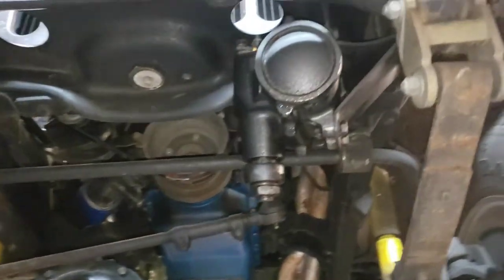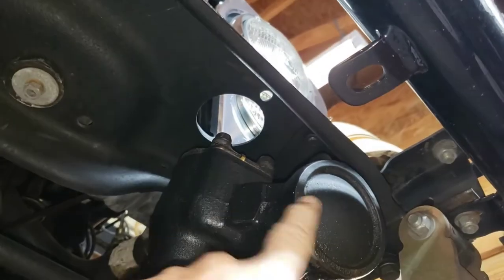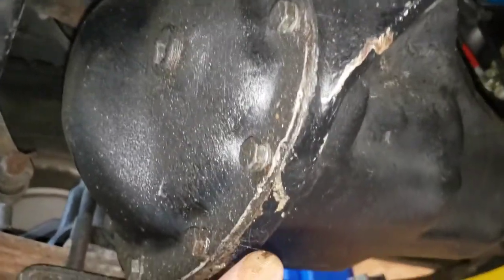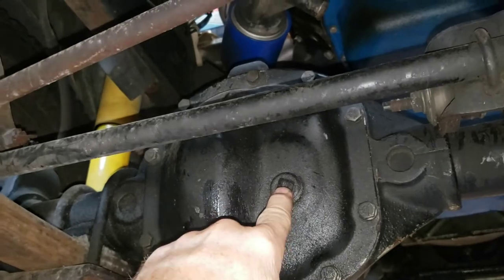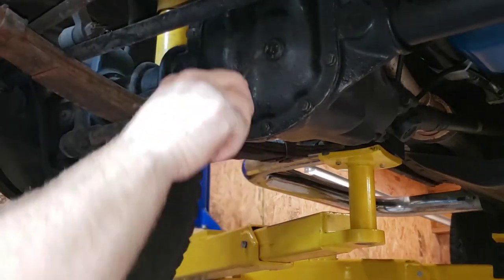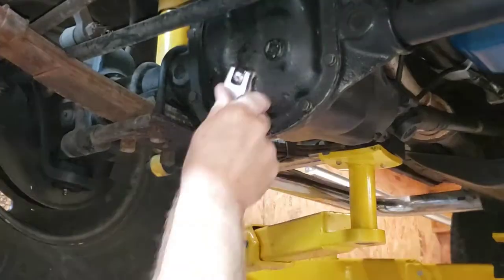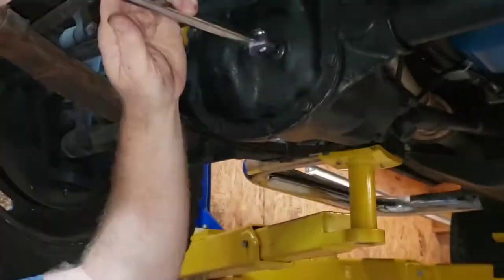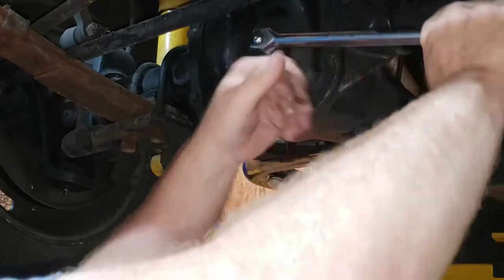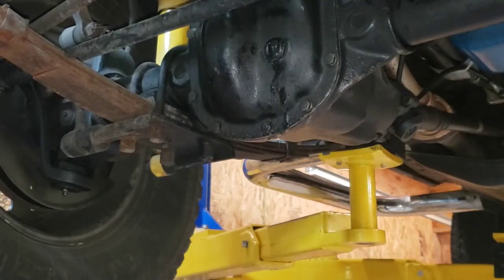While we're under here, I thought maybe we'd just give a routine inspection and see how things are going. It looks like we have some very minor seepage in the power steering, although my fluid level is good, so I don't really see an issue there. It looks like we might have a little seepage on the front differential. I think while we're here, let's go ahead and check the front differential fluid level. I've got a little dirt in the plug there — clean that out so we can get our breaker bar in here. Yeah, it's running out — we got fluid and it looks nice and clean too.